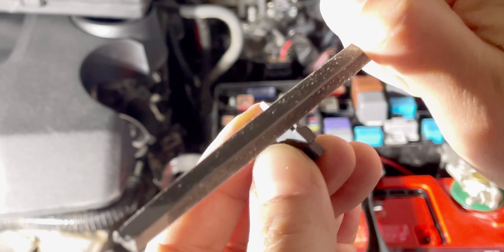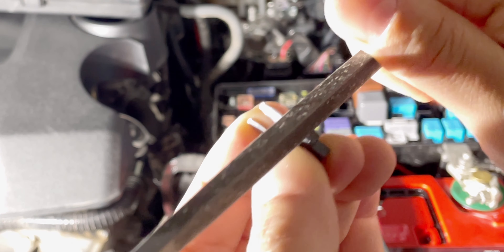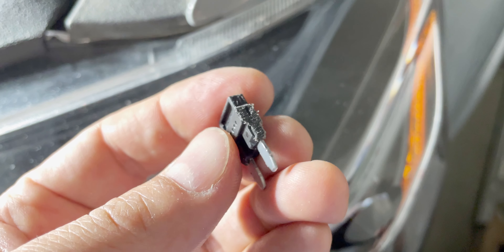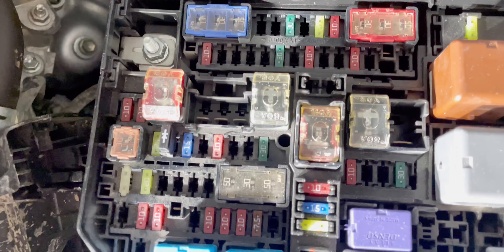This is the GM diode. It has a protruding plastic edge, so you have to file that down — just a minor modification. Get a file or nail clipper and take that part down all the way to the metal, so it kind of looks like this. It's very easy; you just have to file it down just a little bit.